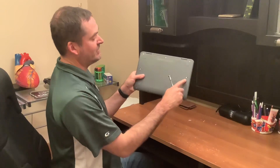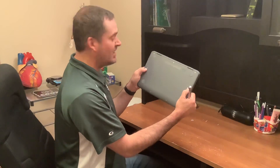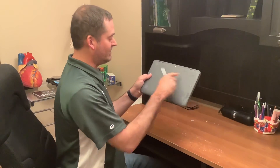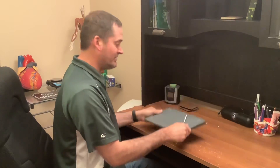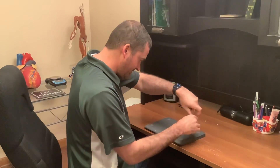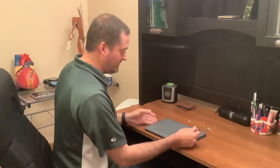The first thing that you need to know is these middle screws are not intended to be taken out all the way. What we're going to do is just loosen those, and then we're going to remove the three up top and the four down low. So let's loosen the middle ones first. Remember that these do not pull completely out of the Chromebook.